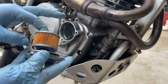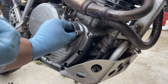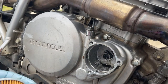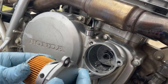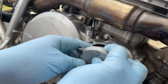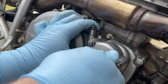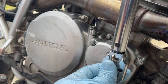The cap basically goes on just like that, then the spring goes back inside. You have to turn it to get it to stay — there's a little nub here to line it up, and the hole goes right up against this. Then just use the bolts to secure it in place. The filter cover bolts torque to 108 inch-pounds or 9 foot-pounds.